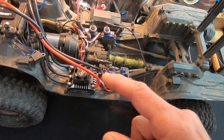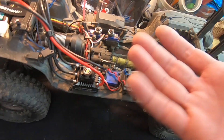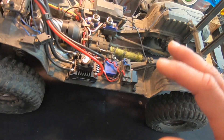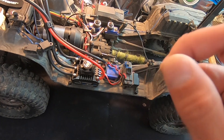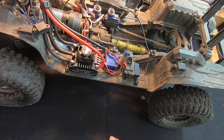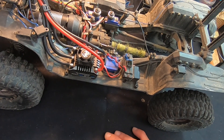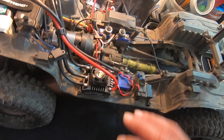The engineers came up with an awesome feature that lets you adjust the kind of stall that's in there. Some folks don't like the way the AXE FOC just trucks along at a fixed RPM at whatever speed you set — most of us love that — but there's a handful of people that wanted a little of that brush stall back. There's a setting for that now; it defaults to the way it's always been, and you can turn it down or up to make it more aggressive. The throttle matching — or RPM matching — is now adjustable, basically adding a brush-motor stall feel to the initial response at low speed when the vehicle comes up to an obstacle.